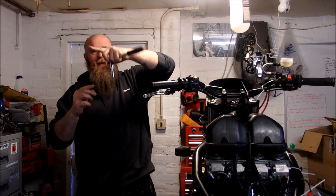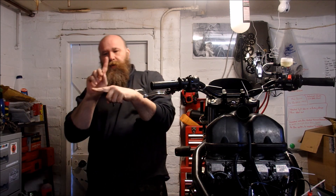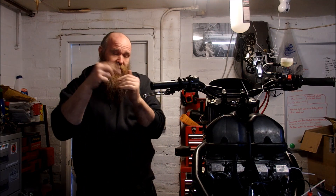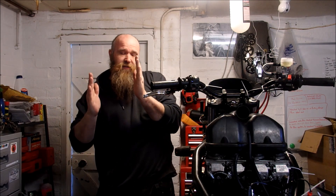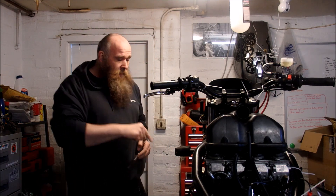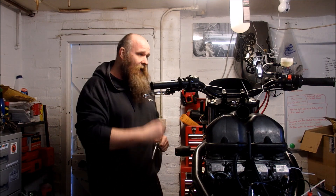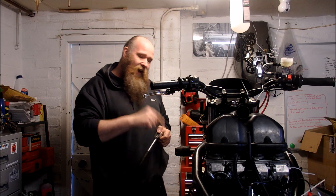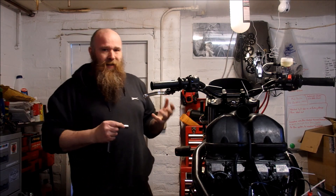The issue I'm having is the banjo bolt. Imagine there are two lines — the line closest to the master cylinder is bled all the way through and you can see those calipers moving. But I'm not getting the same from the other side. It's the caliper furthest away — it looks like pressure is building on one side but not the other, meaning there must still be air in that one. I've pushed about 300ml through that caliper up to the master cylinder and it's made no difference.